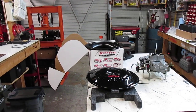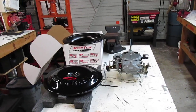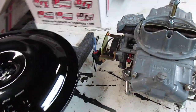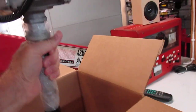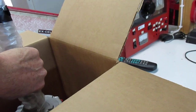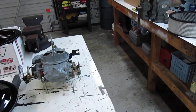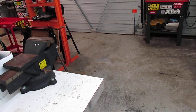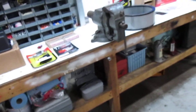It's been a long time since my last video, but about a year ago I started working on a project where I'm going to build a 383 stroker for my '95 Chevrolet K2500. I rebuilt a 670 CFM Holley carburetor, added a throttle position sensor for the electronic transmission, rebuilt it from old parts and a Summit rebuild kit, and made a nice HEI distributor. About three months ago I ordered a top-end kit from Edelbrock, which has been on back order, and I'm adding it to a 383 short block from Blueprint Engines.